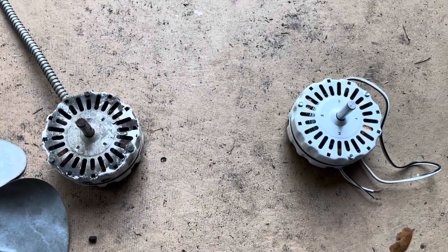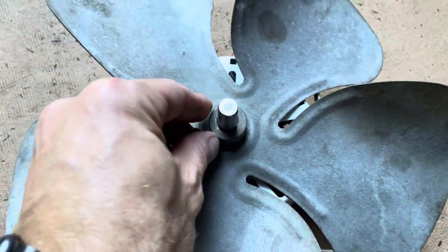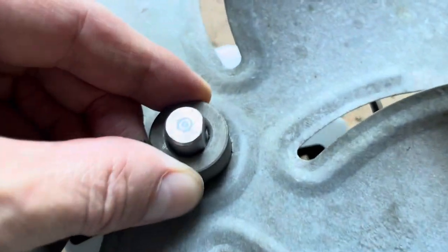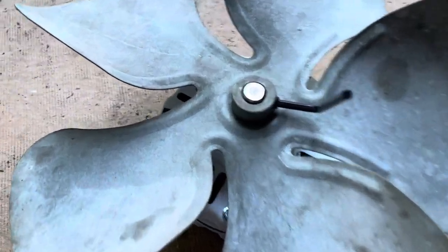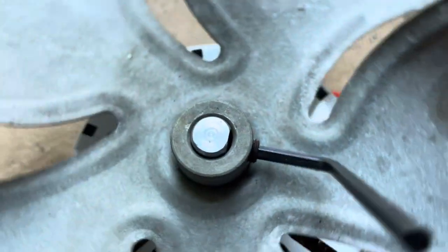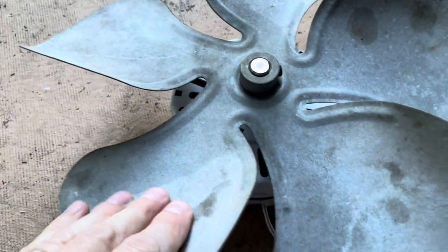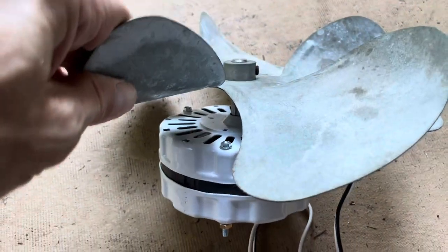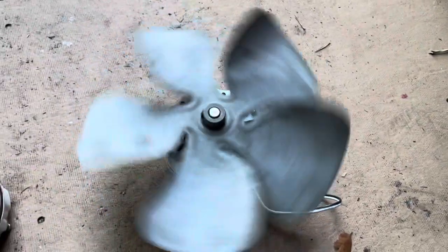Put the new fan blade on there and see how it goes. I'm just going to drop that on there — it was positioned up just about right there. You can see it's just sticking out the top there, and I'll set that set screw. The flat part is right there. Got that set screw in there and you can tighten it just a little bit more. I've got enough space between the fan motor and the fan blade so this can spin freely and not hit things.